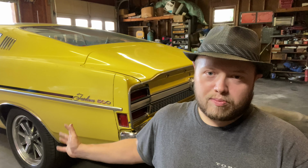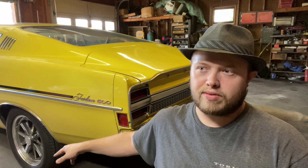And then I figured that they've probably sagged about an inch over the years, and I added an inch to it. So that's why I went an inch above stock. And it worked out perfect. I always keep the car at 26. Before, the driver's side was 25 and a half, and the passenger side was 26.